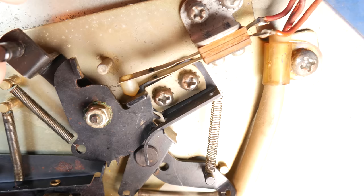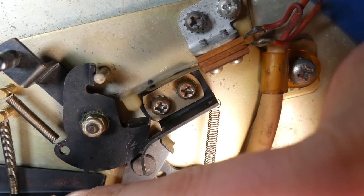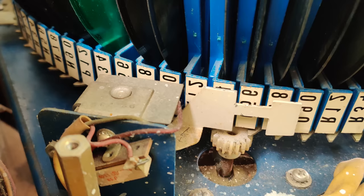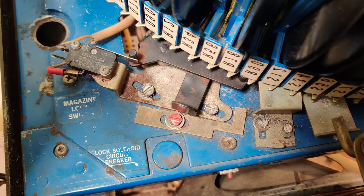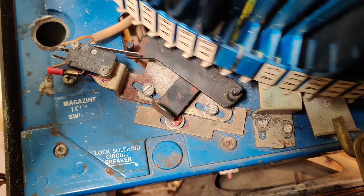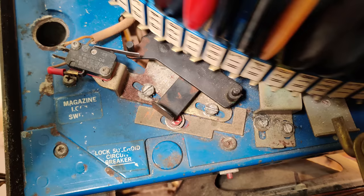All the master power switch that the selection accumulator closed really did was start sending power to the motor that turns the carousel. It also sends power to the carousel lock magnet, which is what's making that loud buzzing. The motor is actually pretty quiet. But fundamentally, that's all that switch does. It just gets the carousel spinning. When the readout switches hit a pin and they energize the side 1 or side 2 relay, the power source from the carousel motor gets redirected to the main cam motor.